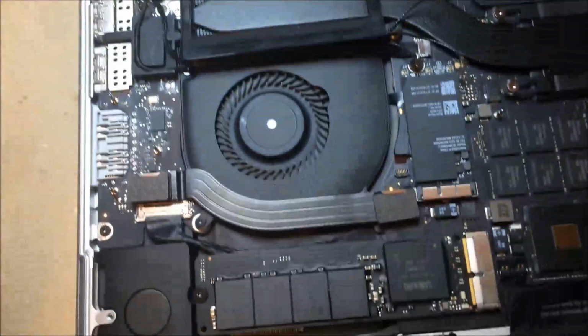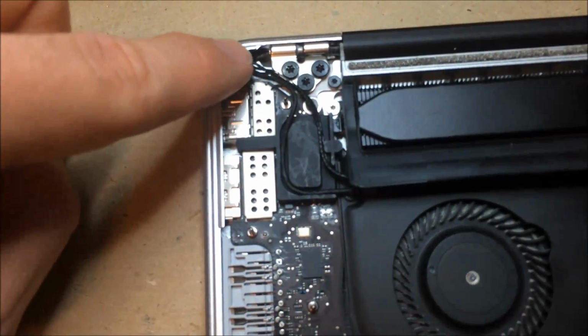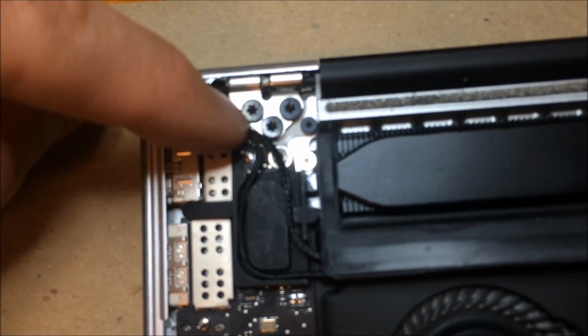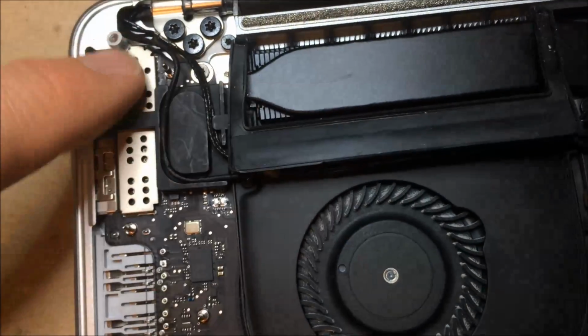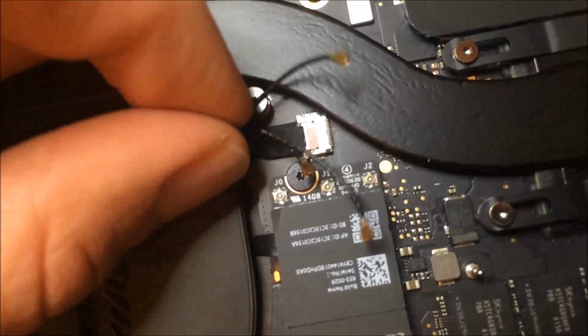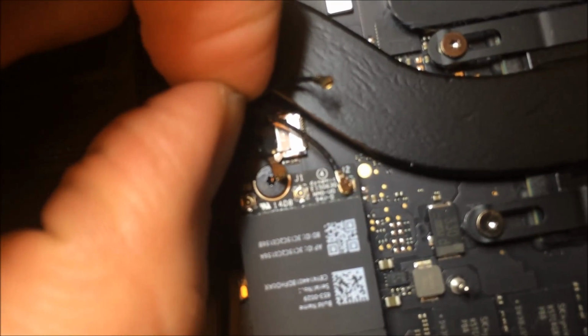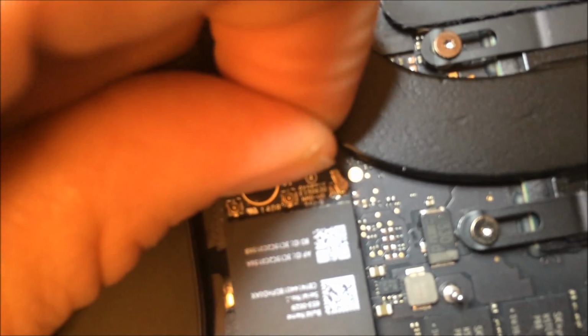I want to add one more thought. After you've put the screws back in and you reroute the cables, make sure that there's a little metal piece that goes under these 2 screws. Make sure that goes back where it belongs. And you want to reroute these back, plug these back in. These obviously, these go where you think they should go. The longest one goes back over here on J2. You kind of put it over top and then click it back down. Kind of need 2 hands for that.